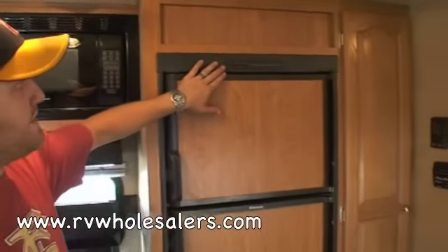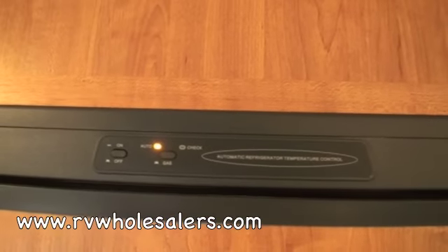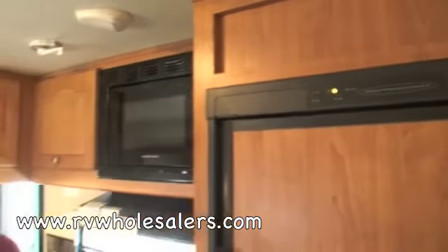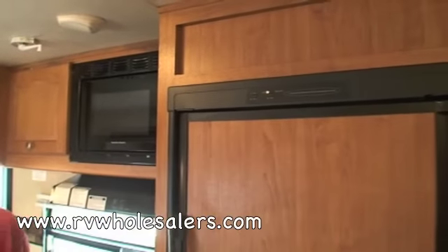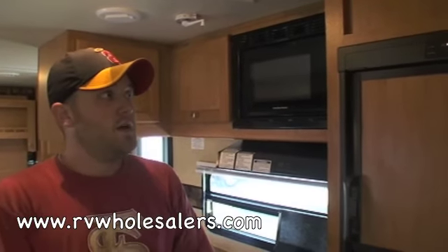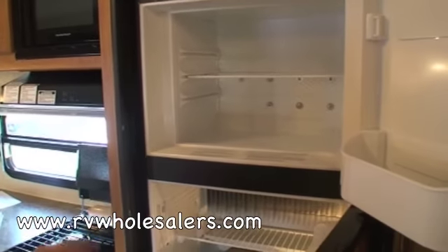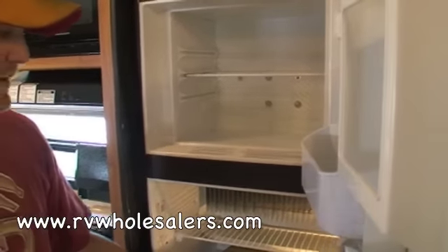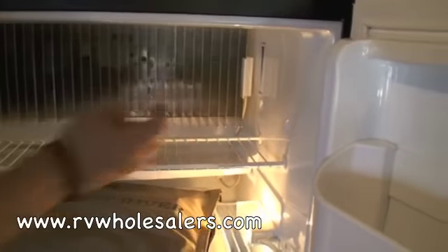The refrigerator — there is an on/off button on the refrigerator. Turn the button on and push it in until the auto light illuminates. Auto stands for automatic — it will automatically search for electric first, propane second. You have to be plugged in for electric. If electric does not kick on right away, it will divert to gas as the secondary. If it does not find gas either, the check light will illuminate telling you that nothing is running the refrigerator on electric or propane. The refrigerators can take up to 6 hours to get 100% cold and they work top to bottom — your freezer gets cold first, then your refrigerator. This little white slat connected to the hose in the back is actually how you adjust the temperature in your refrigerator.